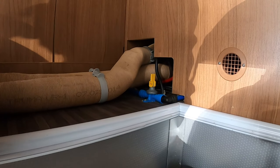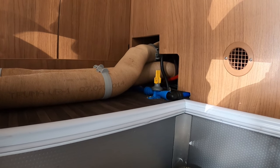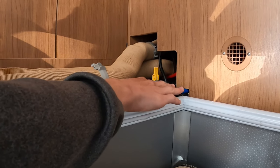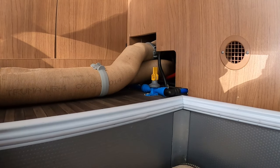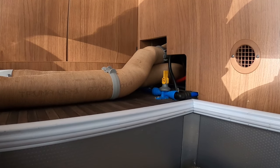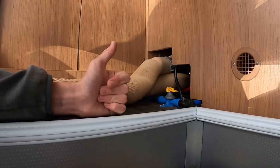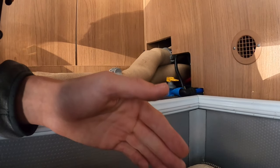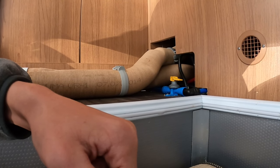This will drain all 10 litres of water in the boiler and stop it freezing. If it were to freeze in the boiler, it's not covered under warranty — it's your responsibility to winterise your vehicle, and it's very expensive to replace or repair. Once you've lifted this tap, go inside and put all your mixer taps in the middle position; this stops any air building up in the boiler and taps so you don't get an airlock. When you're ready to reuse it, lie it down, fill the vehicle with water, put the pump on, and open the taps to the cold side first — it'll cough and come through, then put the hot side on, it'll cough and splutter until you get a steady flow. Do them all and then you are primed for the season.